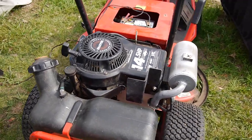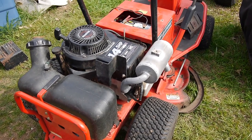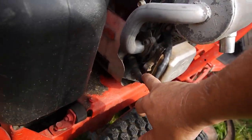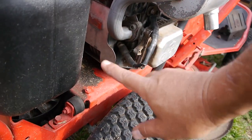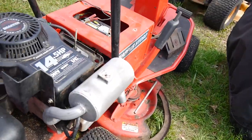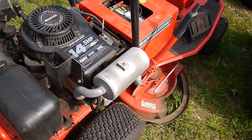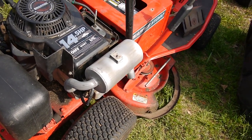Okay, so the battery went out. Didn't know it on my camera, so I went and swapped the batteries. But while I was doing that, what I did, I'm sorry you missed it, I could probably recreate it, but I took the spark plug out and sprayed some carburetor cleaner in there, directly into the cylinder, put it up and cranked it over, and it sounded like it was a lot of short backfires, right? It was trying to fire, but just nothing strong. It just sounded like a bunch of backfires, if you ask me.